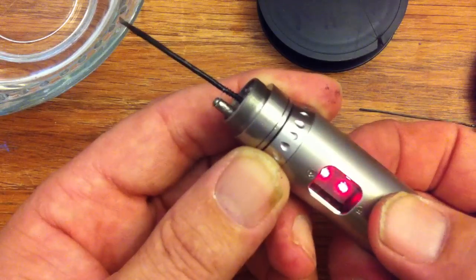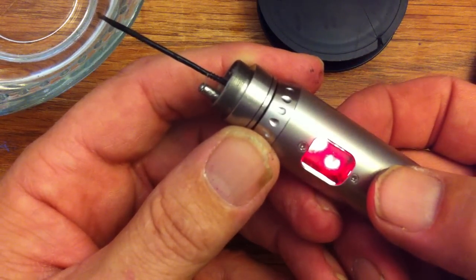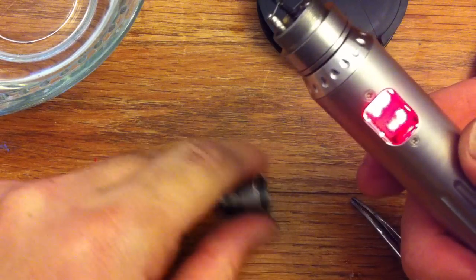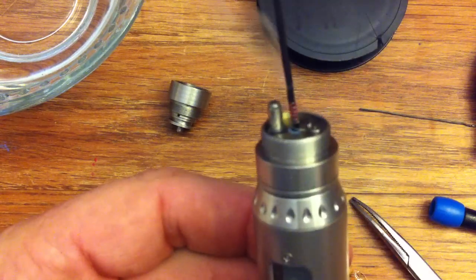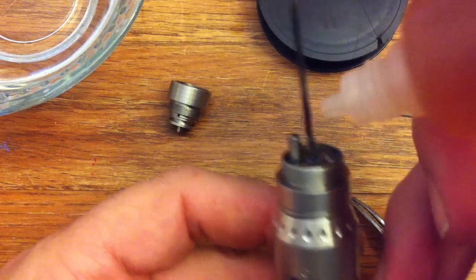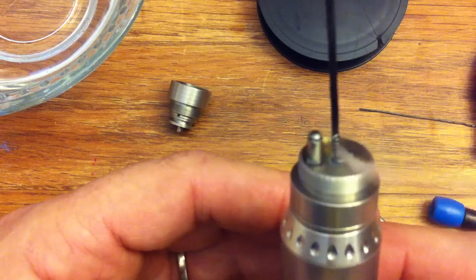Back around. Okay, let me just wait and then do it 5 times. Power up. Now we're going to go to 3.7. Now let's see if it gives us an E1 error or an E2 error. No E1, no E2, and that's what we want. And you'll see the coil lights up perfectly. That's exactly how it's supposed to do. It's supposed to be completely coil illumination, no hot spots, so half the coil's not lighting up. I mean, it's exactly the way it's supposed to be working.